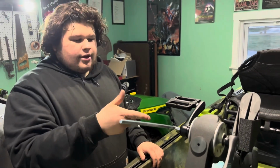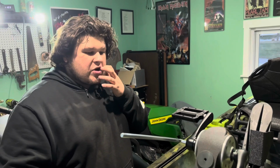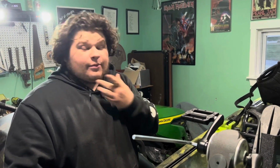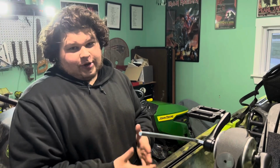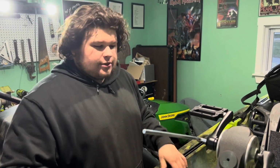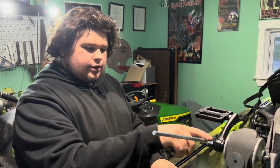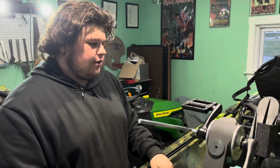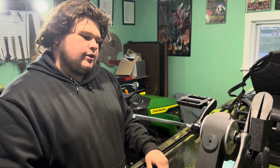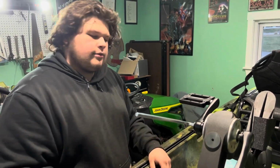Now, Native has a torque specification of 26 foot-pounds for these crank arms. And I'm going to be honest with you, we don't have a torque wrench here, so we're going to go by feel. It's a tapered shaft on the crank arms. So I just put the bolts in for now, and I just snug them up, and I'm just going to go until I feel like they're tight enough to where it won't strip out. But it's a super simple install, just this big Allen that you actually get with the boat and the screws that you get with it.